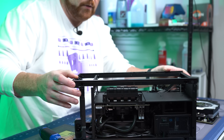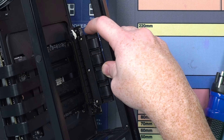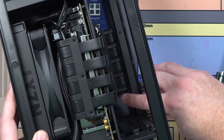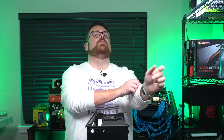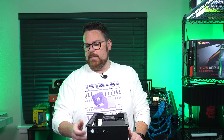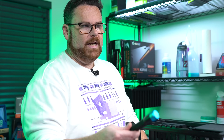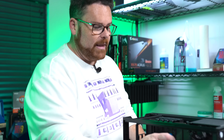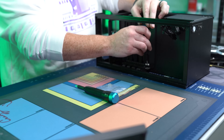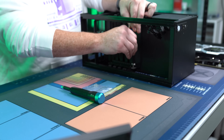On the riser cable, you'll see there are two screws. They're black, and they're on each side. These are the two screws we're going to remove. I want to be super clear about something — these screws obviously they did not mean for them to be able to come out. So we had to use a couple of screwdrivers to get these out. They can be tough. We are using iFixit ones. We were able to get it from an angle, but just know that there's going to be some struggles.